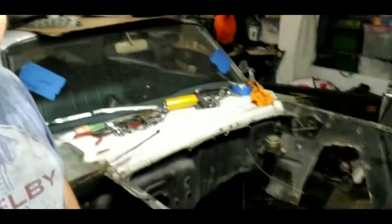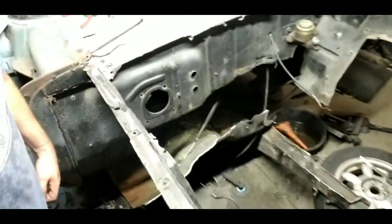What's up YouTube, it's another 100-plus degree day slash night, so I am messing with the Falcon again. I am finally cutting the floor out of it. I trimmed down the other frame — this is still a rough cut, so I left extra metal because it's easier to trim than it is to try to replace it unless you've got all the tools.